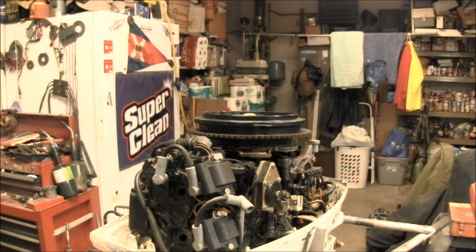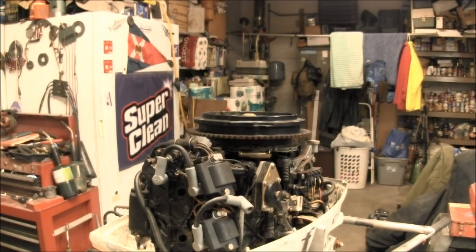But I think even with those numbers, it's a well-used engine. Both of them are down in the 80s, 90s. And to me, that's not a motor I would most likely sell to somebody. I might fix it up good enough and give it to them, but it's not one that I would sell. I like to have over 100 PSI. So this would be a fine block that I could hone up, slap some new rings in and so forth. But I'll pull the head off, if nothing else, because I want that brand new head gasket that he put in there. So, let me get to pulling that off.